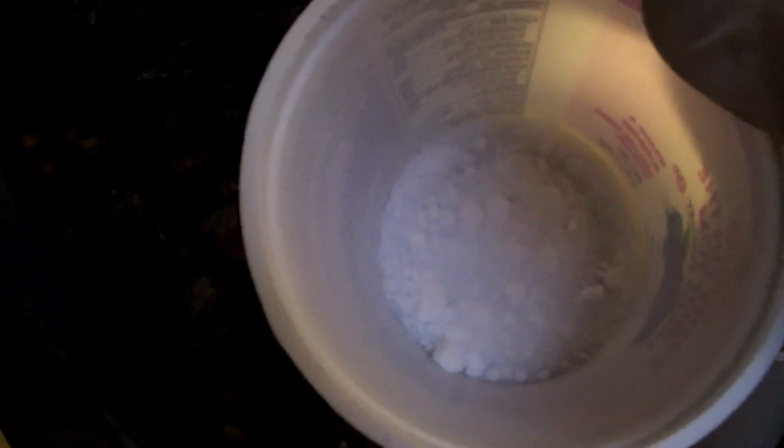So I've got 3 of that size, 3 of this size, and 3 big ones over there. That's what I'm going to layer up now, but before I do that, I'm going to mix up some thickener. Gosh, it totally escaped me what I use, my powder stuff, I can't think what it's called. I'm going to thicken that up, because this is a little bit of a depression, and I'm just going to fair that out, fill that up before I put the layers of glass on. So, start laying it up.